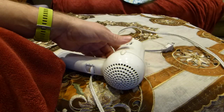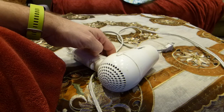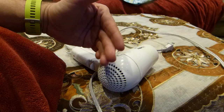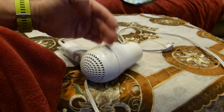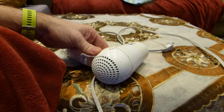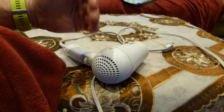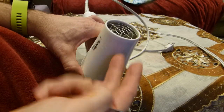It takes in air, blows, dries your hair, until it overheats again. So why does it overheat? Why does the thermal fuse switch off and open the circuit, switching on and off and on and off — why does it cycle like that? The reason is because there isn't enough air flow through the device, that's why the heating element overheats in the first place.